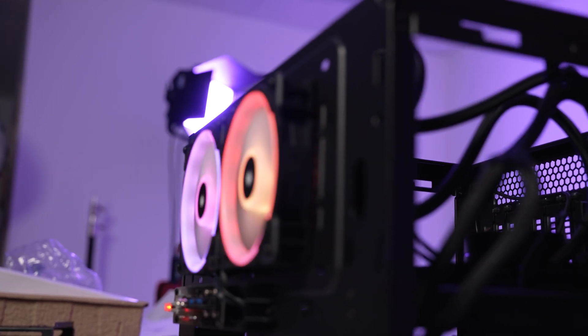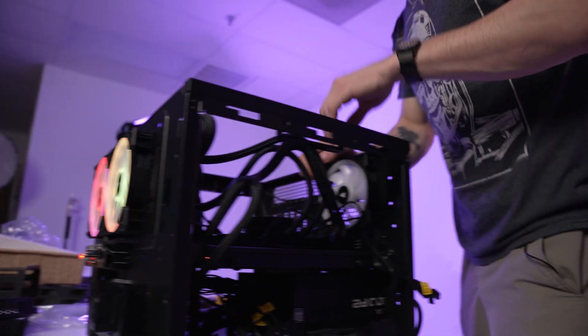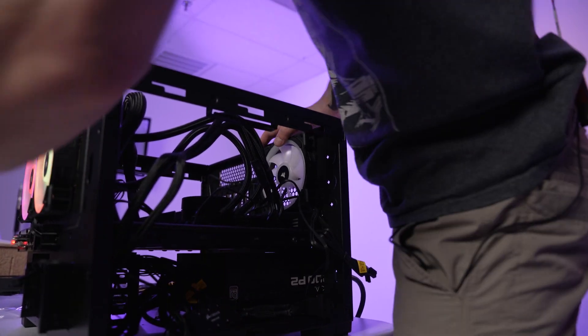One last component in relation to airflow: high-quality fans. A PC case will usually come with at least two of them, but make sure to check the packaging and details when you order. My case came with three fans, which I replaced with Corsair RGB ones primarily for the look. But prioritize reliability of the fans over their shiny look. Make sure that your airflow is either front to back or back to front depending on the case, so that the air can come in easily and go out easily, keeping all of your components cool and hopefully happy.